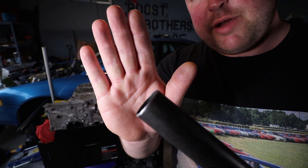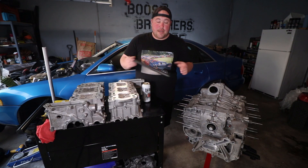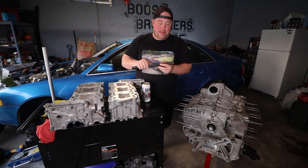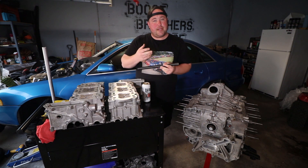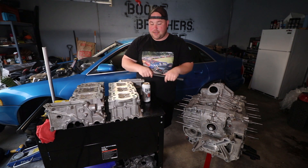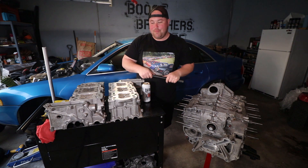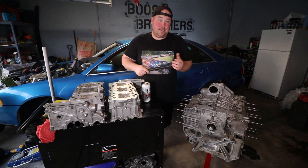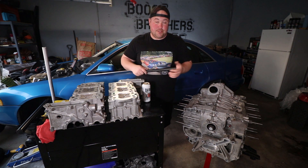So what I had to do was to just ever so slightly file down the edge of this tool. Gave it just a little bit of a bevel. In the minute I had everything lined up and slid this in, fully engaged into the piston, it was easy to hold in place, slam the circlip in — it was considerably less stressful. I'm not gonna say it's easy, but to an extent it's pretty easy as long as you know what you're doing and you follow the correct steps.